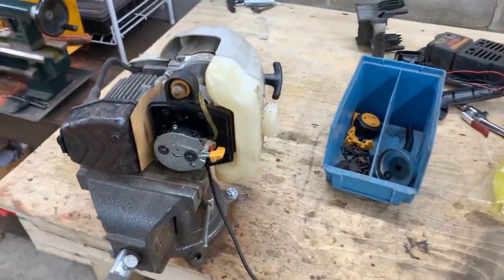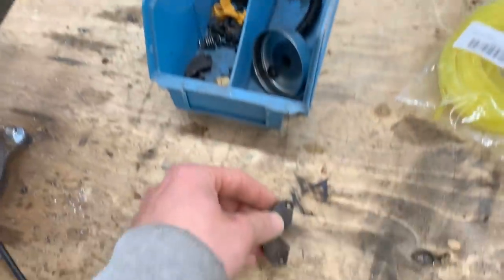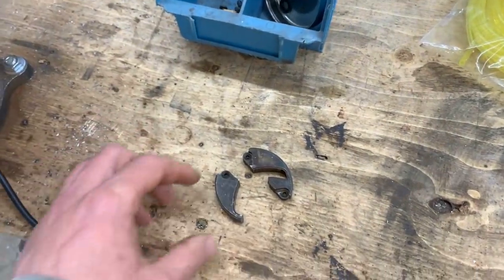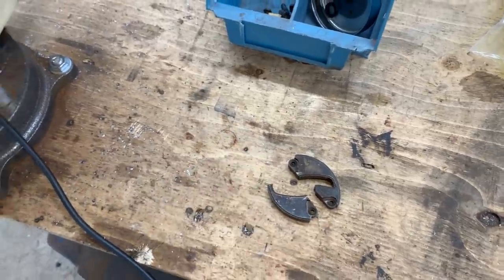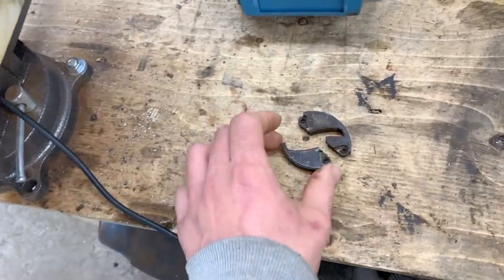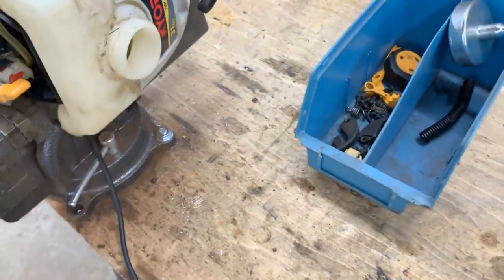Okay, it's a few days later, and the other night I was able to find some of the parts that flew away from the clutch. I didn't find all of them, but to be honest, I didn't spend much time looking for them, because whatever I found didn't look very promising. So, yeah, that was stupid of me to run it with the clutch without the drum. Because the drum would have kept it together, but since there was no drum, the centrifugal forces were so strong that the clutch broke. So anyways, I ordered a new clutch, it's on its way.